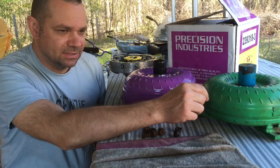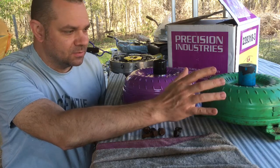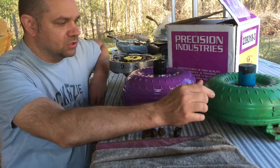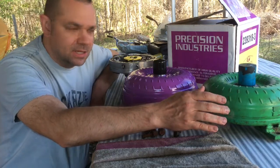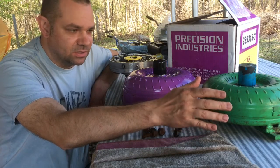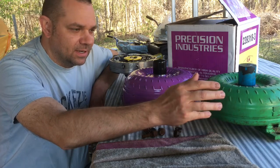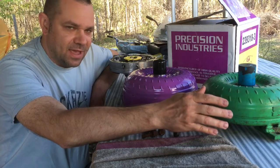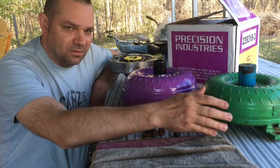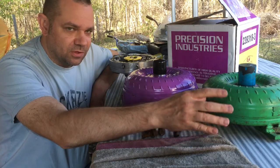This converter is supposed to be 2,600 to 3,000 RPM stall, but it was flashing to 3,200 RPM — way more converter than I wanted for the street. I had a Turbo 400 in the car and it was really tight — it would trip the tires when it shifted. When I put the 200-4R in with the higher stall converter, it worked better with the cam, but it was still too much converter for the car and the part-throttle shifts were very soft.